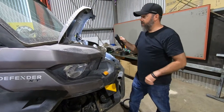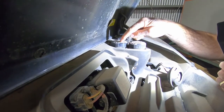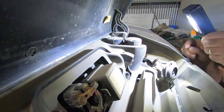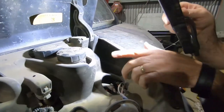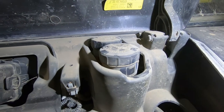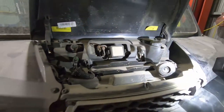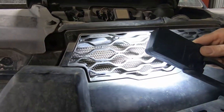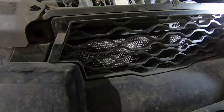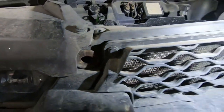Next we'll check the brake fluid levels. These are your reservoir bottles here. Funnily enough, the back one is for the front brakes and the front one is for the rear brakes. You can see the max and minimum levels on the sides — clean them off so you can see clearly. That one's right up to the maximum level, so that's completely fine. While we're here, we'll also have a look at the radiator. That one's nice and clean, but if it does need cleaning you can blow it out — this front panel comes off quickly with these speed clips.